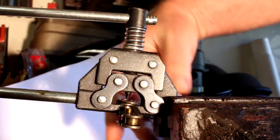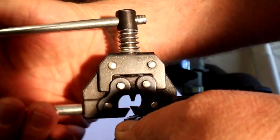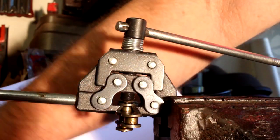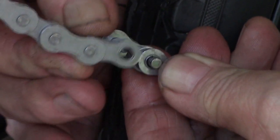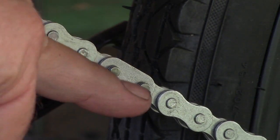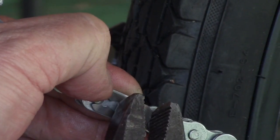Newer chains are pretty stiff and it can be hard to get that pin out even after popping it loose. Sometimes you need to wrestle with it - I will often use the chain breaker tool to finish the job, putting the chain back into it to push out the chain link. Sometimes even that's not enough and I have to use needle-nose pliers or a flat-blade screwdriver to pry the pin out. Once the chain is broken, pull your two pieces close together, put the connector link in, and put the plate over the two pins. Think about the direction of rotation - the chain moves in that direction - and you want the closed end of the snap ring to go in the direction of travel so in case it hits something, it won't get knocked off.